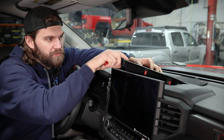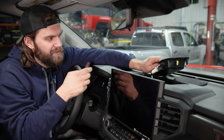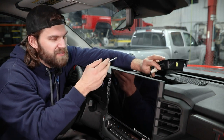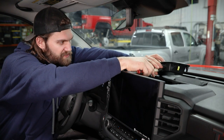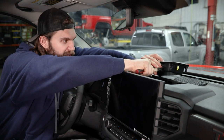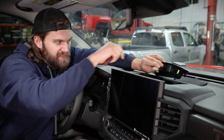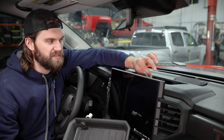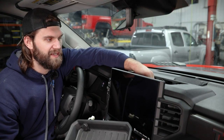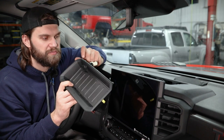Then you're going to need to remove the factory 12-volt plug from this. I'm going to spin it around so you can see that. I'll start by just disconnecting this wiring connector — there's a little tab that can be pressed with either a flat screwdriver or you might be able to get it with your finger. And then just carefully pull those two apart. You can just let the vehicle-side wire harness hang down in there for now.